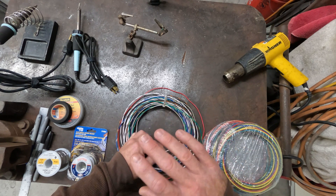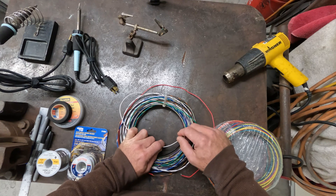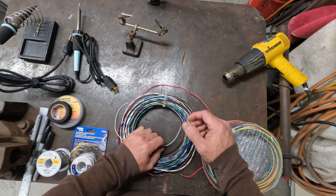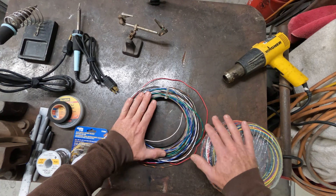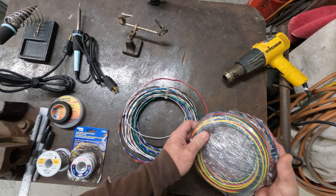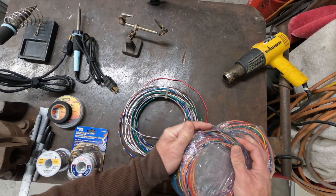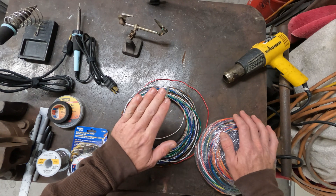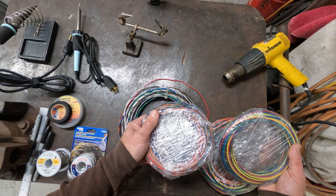Not all automotive wire, especially from some auto parts stores, is created equal. What I mean is some wires are made where they're not around heat sources, and for a motorcycle you're not getting far away from the engine — your heat source is really close to where your wire looming is going to be. Here I have a TXL and a GXL type of wire. You can search for these; I get mine on eBay in rolls with 8, 10, or 12 colors, with stripes. I commonly use 18, 16, and anywhere from 14 to 10 gauge.